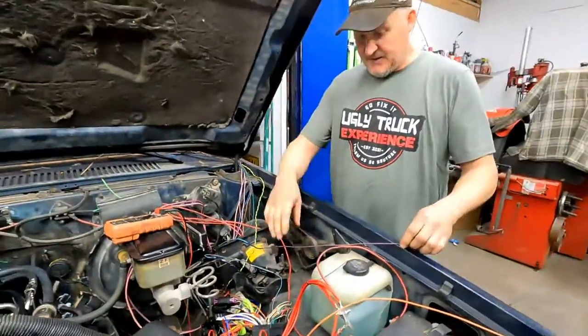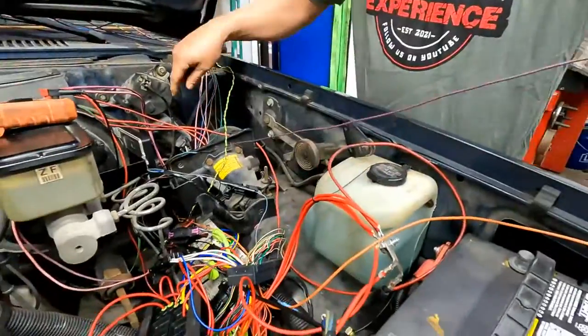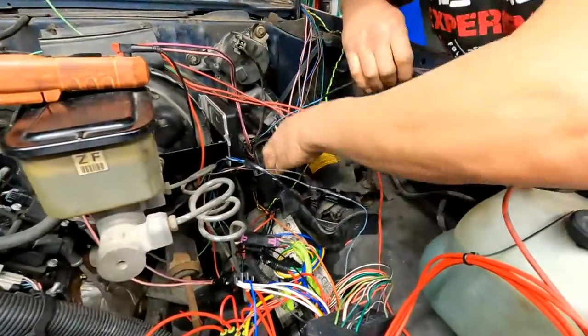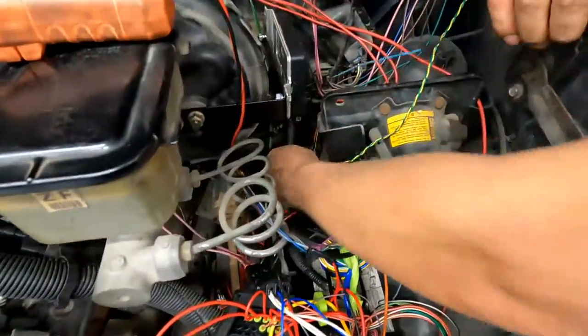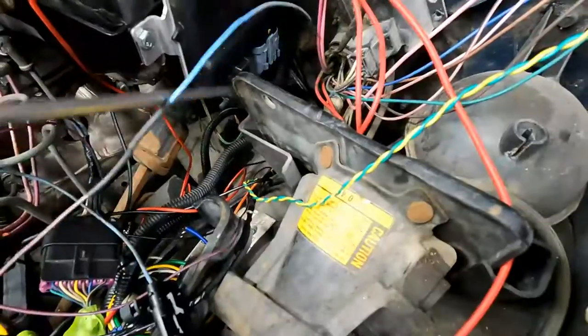The wire that we're gonna find, it's purple too, so that's why I used a purple one. I'm gonna go in the truck, I'm gonna pull it back through here, and then I'm gonna run it out next to the rest of my cruise control wires. You wanna watch it while I pull it through? Sure.